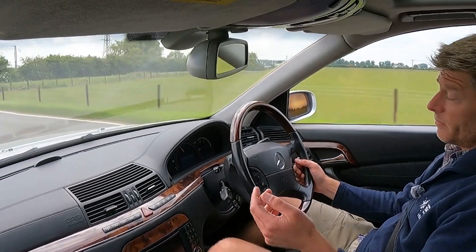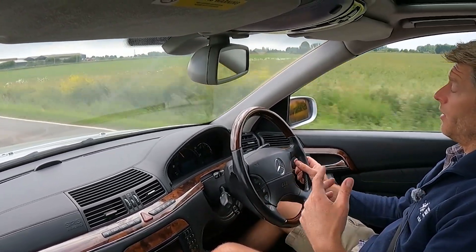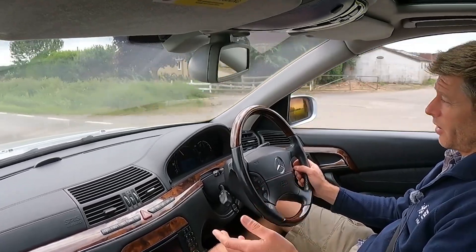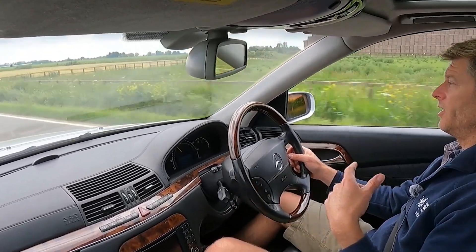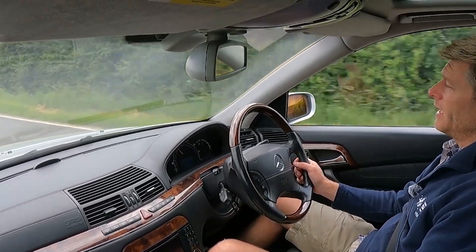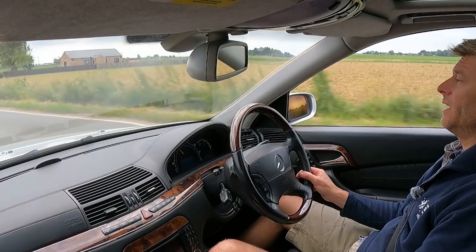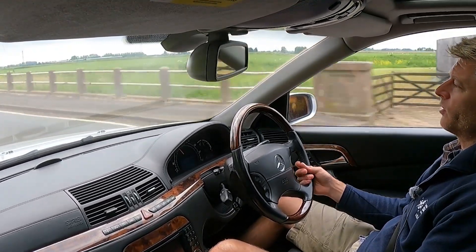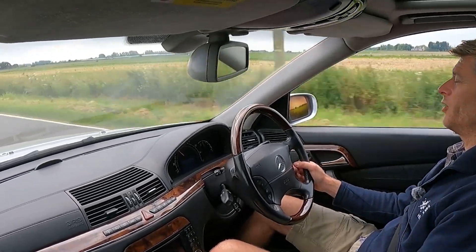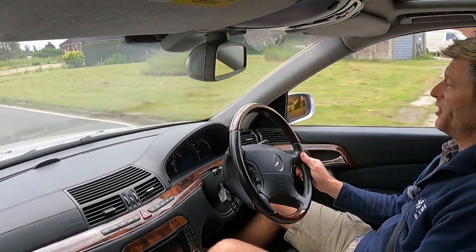The other issue I described in my review was a thump in the gearbox - it got stuck in gear. It would go into limp mode sporadically, usually under hard acceleration. It's almost like a slip and a thump, then stuck in gear. You'd have to turn off the engine, restart, and reset. This happened a handful of times. I got the gearbox fluid and filter changed, which made the problem much better, but I still had it a couple of times. From what I'd read, it seemed likely to be the speed sensor - the plate on the gearbox probably needed changing. My local garage didn't want to do it. Taking it down to the specialist, he confirmed that's the issue and it needs to be sorted.